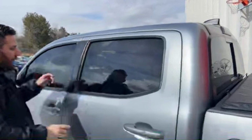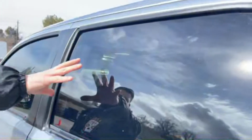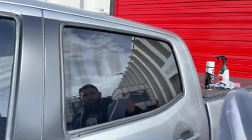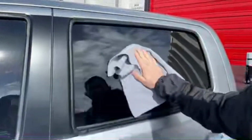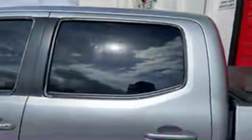And a little bit goes a long way. And I don't know if you can see this, Elin, but if you get VRT or graphene VRT or all-purpose exterior dressing on the paint or the glass, I did it on the glass because it's much easier to see, it's very, very simple to get off. You're just using a microfiber towel, or you could even use a little bit of detail spray, but on these things it tends to wipe off very, very easy. And the all-purpose exterior dressing, being an acrylic formula, is going to need a little bit of juice, so you need something like detail spray to get that off.